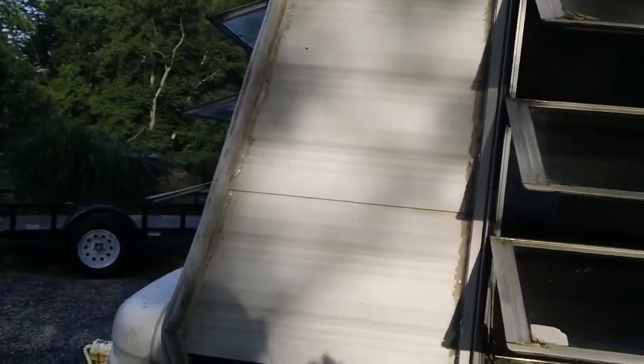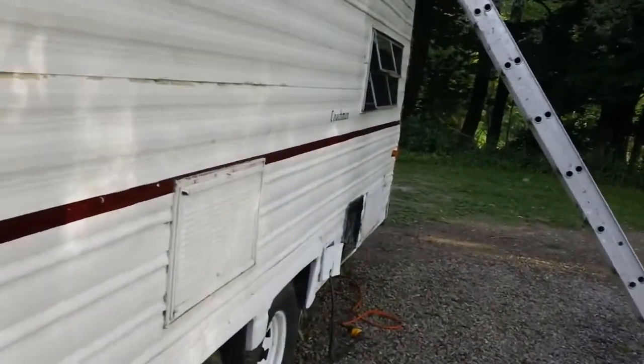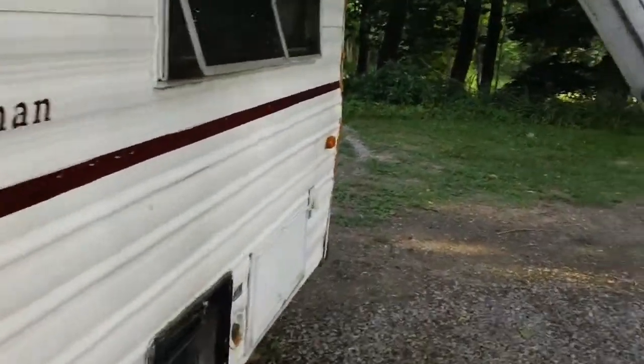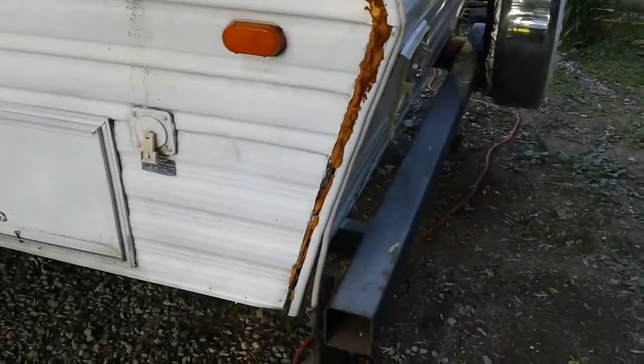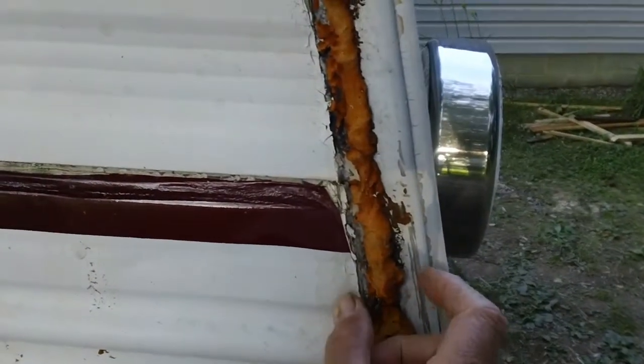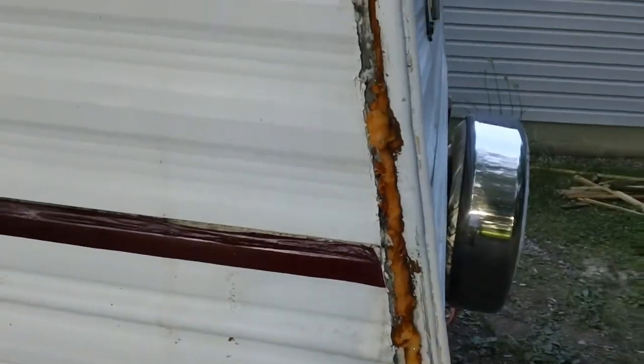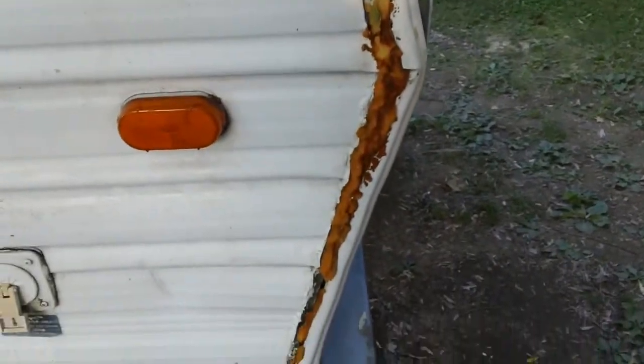And I will take you around back here and show you one that hasn't been repaired. There was three corners that was in pretty bad shape. Here's the last one that has to be fixed. As you can see, this corner right here is the aluminum, and it has this much gap in it where it's just spread apart from water getting in there and bulged out. A previous owner had put their foam spray in there.